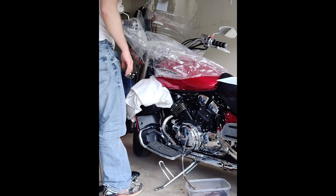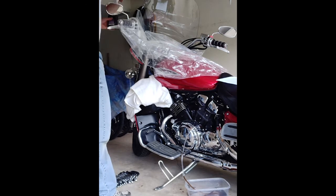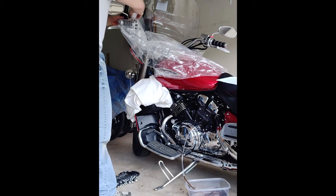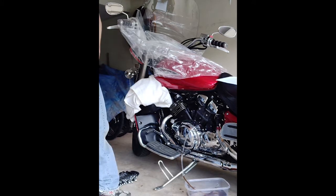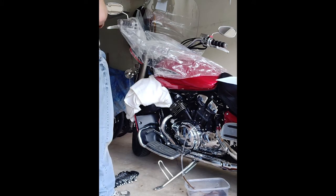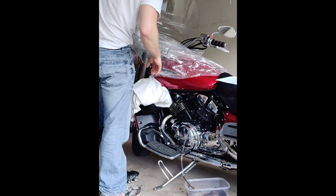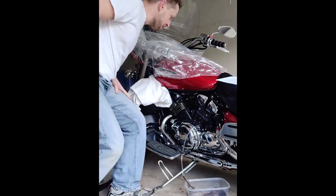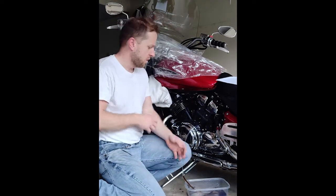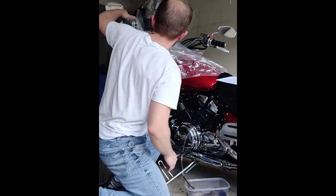Let's check the amount of brake fluid in the reservoir again — add some more. Once the reservoir was refilled, put the diaphragm and reservoir cover back on top and continue bleeding. A very clean brake fluid is coming out now, so it appears the old burned-out fluid has been pushed out.